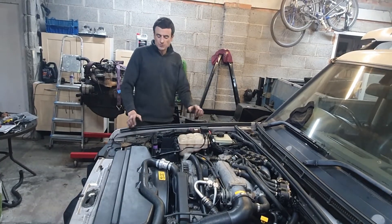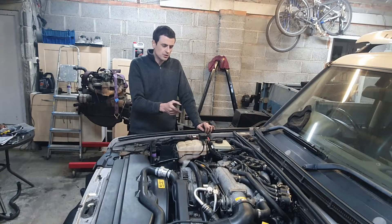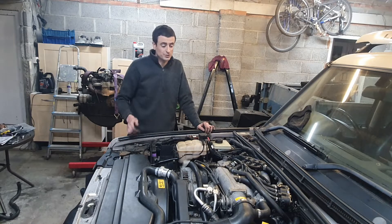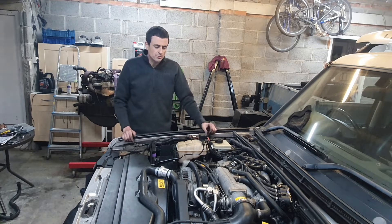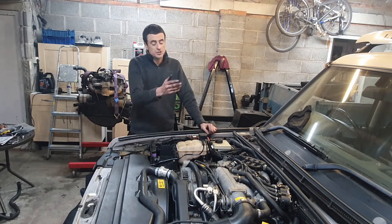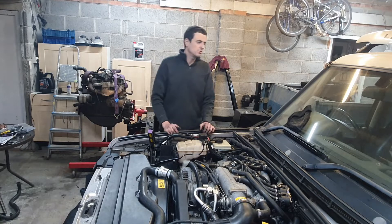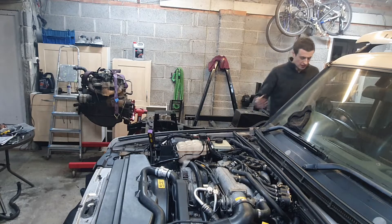Right, time to spin it over. I've already done this on the stand with this battery, so hopefully it'll spin for a bit. All this ignition time gives it a little time to put some fuel in the fuel rail as well. This particular model of Land Rover doesn't have a return line, so I don't know how they work all the bubbles out, but the fuel rail's reasonably empty. I assume it'll fill with fuel and the air bubble will get smaller under pressure — I guess around four times smaller depending on fuel pressure. The injectors won't be firing because the LPG ECU is disconnected. The spark plugs are out, so it should just spin nice and quick, and I want to see that engine oil light go out. I know it works from the stand — I'm just priming it again — so I'll give it about 30 seconds.